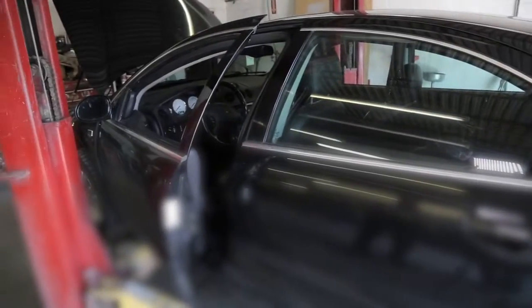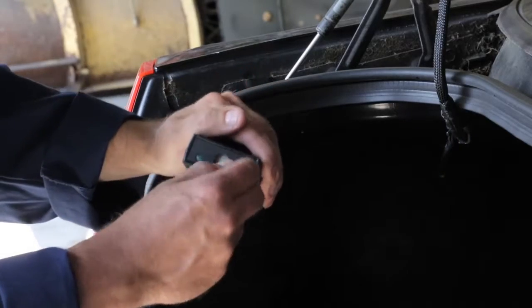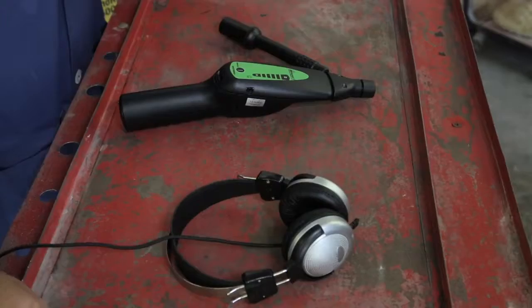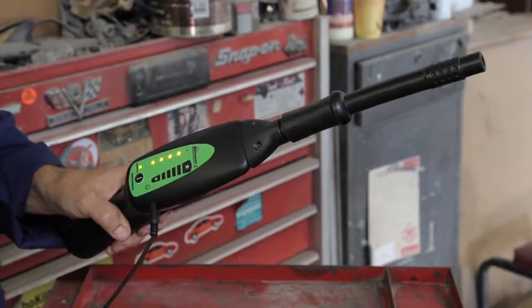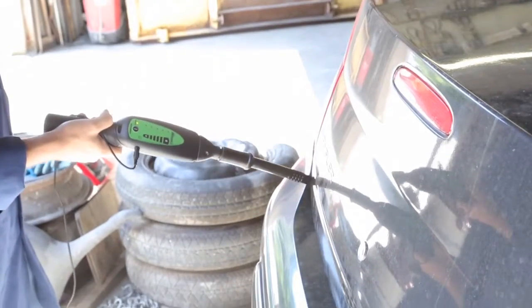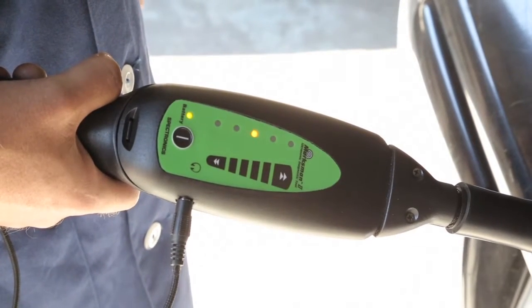Every time it rains, this car's trunk fills with water. Turn on the ultrasonic emitter and place it in the trunk. Attach the air probe to the nose piece, plug the headphone jack into the receiver, put on the headphones, turn the receiver on, and adjust the volume. Slowly scan around the outside of the trunk and check for leaks — the ultrasonic beeps from the emitter intensify as you get closer to the leak. This car has a damaged trunk lid gasket.